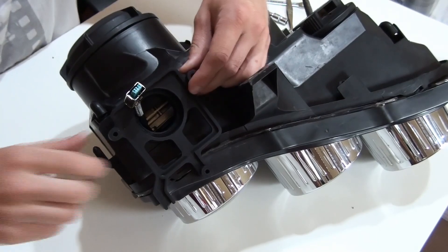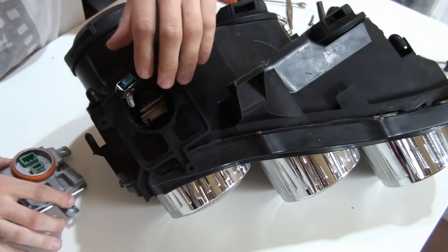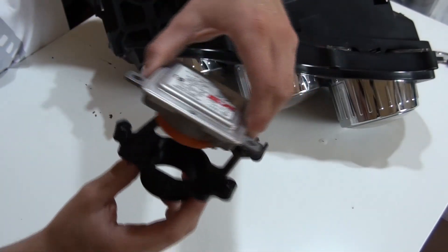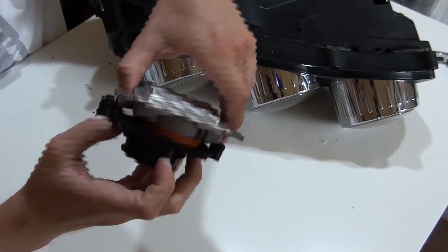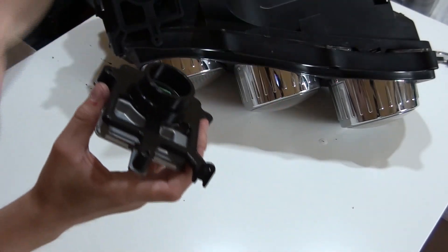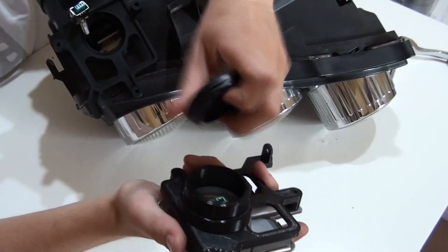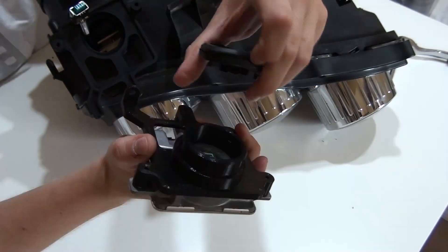So how does this hold to the headlamp itself and how is the ballast mounted to this bracket? I designed this bracket in a couple of prototypes. This thing here is this prototype. It's meant to be put together like this so that this seal goes into this recess here. And then after you assemble it, you use three screws here, here and there. And then using a rubber grommet like this one, you put this grommet over here under this lip just like this. Using this lip design, I managed to support the weight of this whole assembly just using this rubber thing.